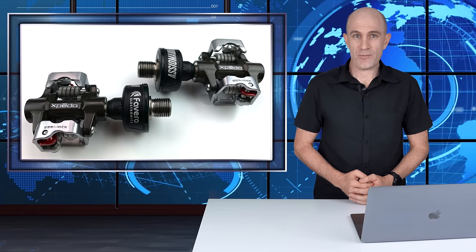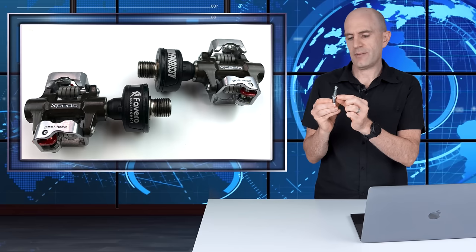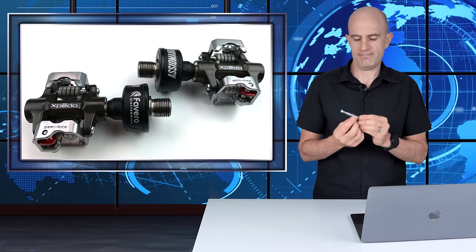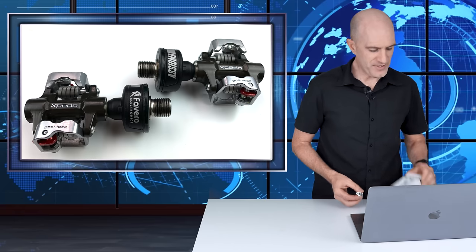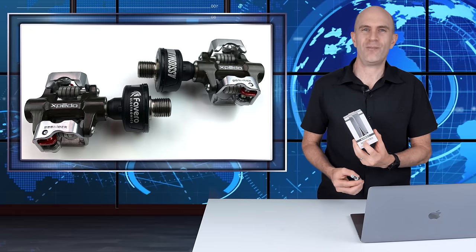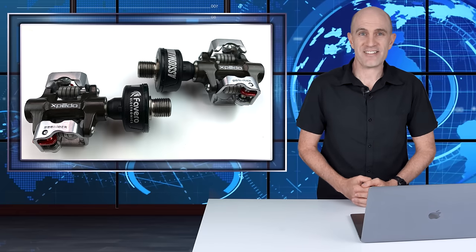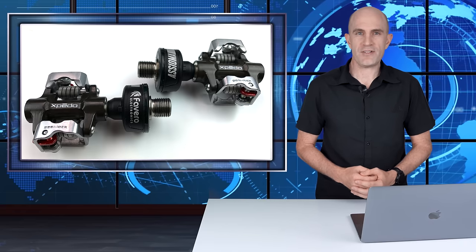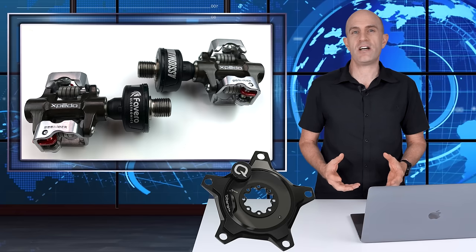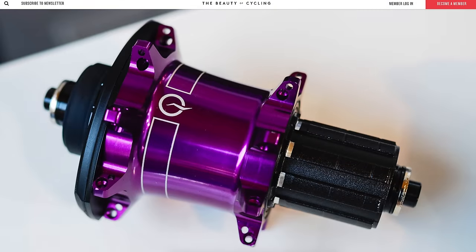What we're seeing so far is this working very, very well. A few ideas to maybe improve on this: the first would be to use the end cap or oil cap that comes with the mountain bike pedals — there's a little rubber grommet on the inside, a little seal, which may add a bit more waterproofing or dust proofing to the bearings. Another thought along the lines of 'if it's not broken, make it better' would be to find some lighter pedal bodies than the Expedo M-Force 4s, which were quite weighty. There might be lighter options out there to trim the pedals down a bit. So there we have it — the conversion from start to finish for my dual-sided, mountain bike SPD compatible power meter pedals. My use case will be very similar to what was posted on the forums: gravel riding and maybe some light mountain biking. More hardcore mountain bikers might be better suited to something like a Quarq DZero DUB in a spider, in a more protected area, or maybe waiting a bit longer for the PowerTap G4 hub, which is a disc-compatible rear hub power meter.